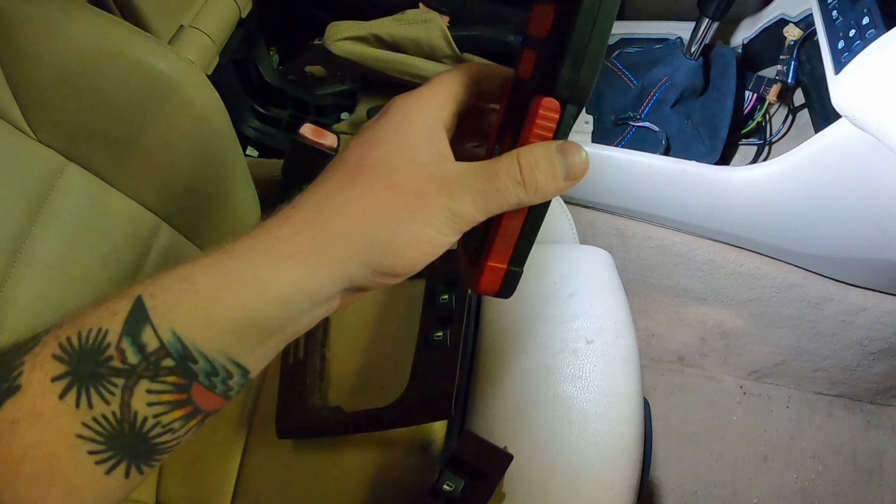But anyways, we're doing a Chase Bays line relocation kit / ABS delete, which gives you a bias valve, gives you some front brake lines to run up to your soft lines rather than the factory hard lines. Little back brake tee off here. So that's going down. We also have some PMC knuckle adapters, which give you the knuckle adapter, of course. And they also give you these adjustable outer tie rods. So that's gonna give you the Heim joint as well.